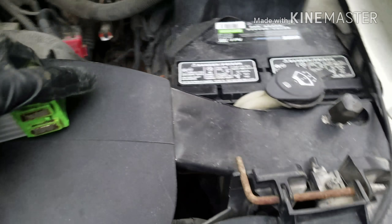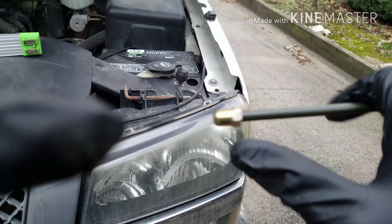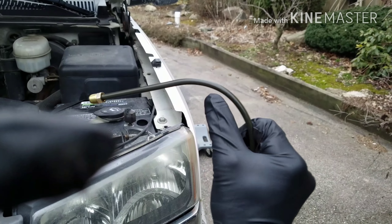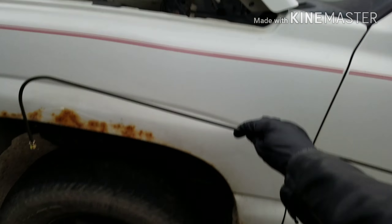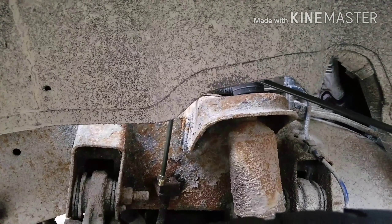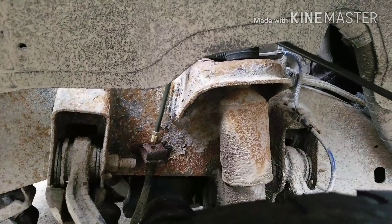This is just a straight 60-inch brake line and it's got a nipple on both ends. I actually already bent it just where I need it. When you bend these, you want to bend one area and then bend another area and just take it easy — you don't want to kink it. It's just gonna go in the truck like this, go back to the ABS module, then come up and come down right here, and plug in right to there. This rubber hose here goes down to the brake caliper.